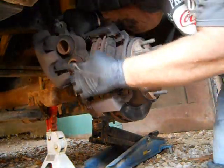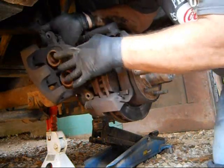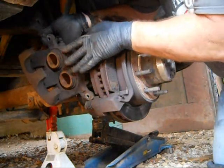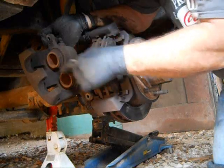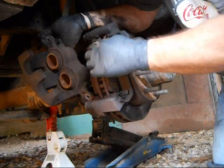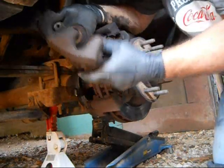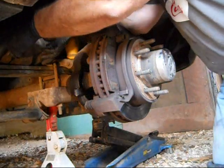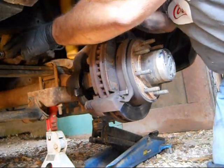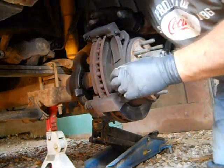You can see these are the two cylinders here. The brake fluid, when you hit the brakes, moves them out to push the two brake pads together against the rotor. Don't leave the caliper hanging — you want to tie it up and find a good solid place to support it. Leave it hanging by the hose and you could cause yourself some problems.